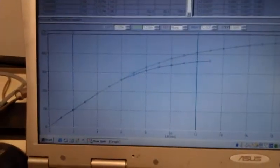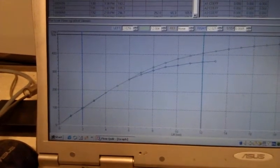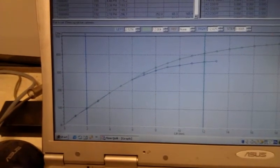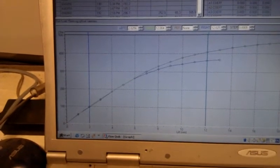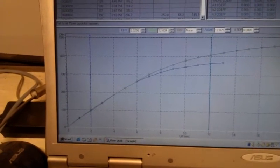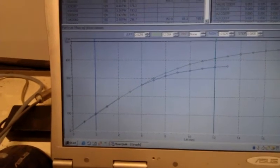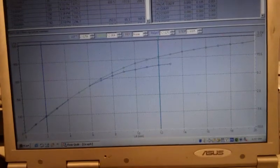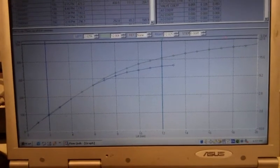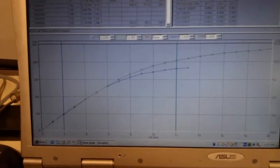So in numbers, it looks like this. The lower curve — I stopped flowing at 13mm lift, because it simply stopped at that stage — that's the standard port. After filling it up with the putty and the better radius, it continued, although the engine needed a lot of lift. As you can see, I flowed all the way up to 20mm lift, which is not possible to reach in the current setup.